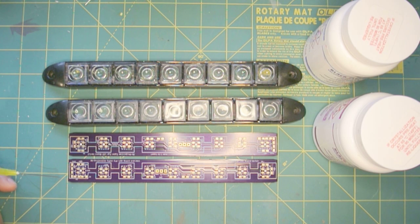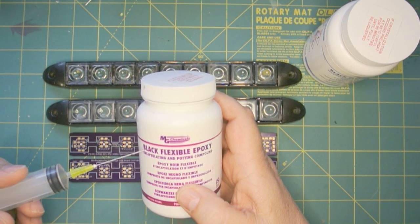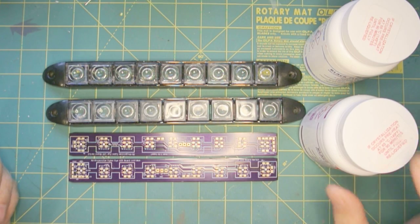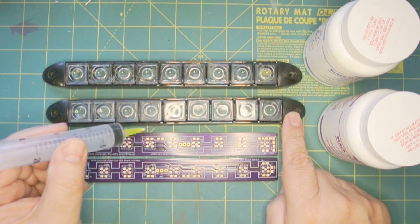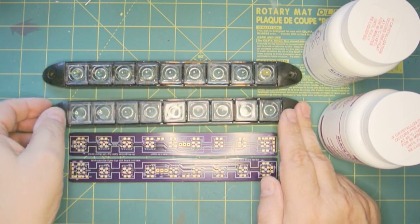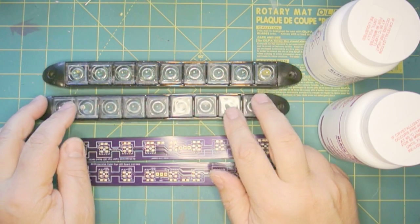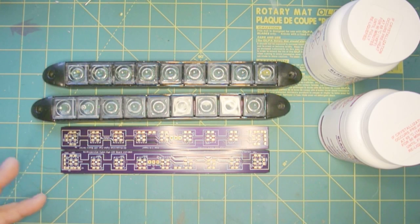The other possible issue is this may be leaking a little bit. Last year I found some black flexible epoxy potting compound. Typically potting compound is made of epoxy so it's rigid, but this stuff is more flexible. I mixed it up in a syringe and ran it all the way around the little channel here, between all of the lights. And even though there's epoxy on here, it is somewhat flexible, because when you put it on the RV it's going to be bent just a little bit. So I'm not sure whether it was a leak issue, a transient voltage issue, or a combination of both — I just went ahead and did both.